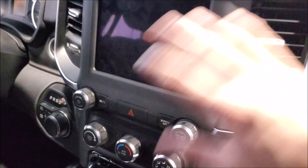These vehicles are so computer controlled now, and RAM used to put the power plug roughly in this area — they've moved it up here. So once I remove this, it's easy to run wires up. If you're adding a dash camera or need remote turn on for a stereo, I really do prefer 12 volt turn on for aftermarket stereos as opposed to signal sense. I think it's more reliable, and it's easy to get it from here.